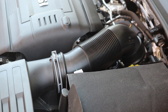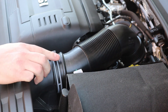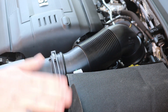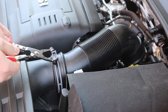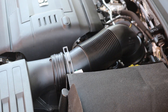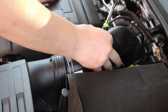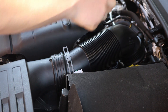The first step in this process is going to be to remove the pipe of the air intake. To do this, you will need hose clamp pliers. I actually tried to do this without hose clamp pliers and it's not worth it — just go spend the money and get the tool. There's another hose clamp in the back which you will need a 7mm socket or wrench to get to. If you still have the stock intake like I do, it's not very easy to get off — you don't really have a whole lot of room.